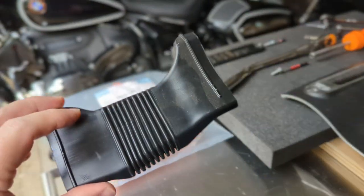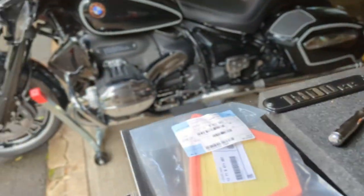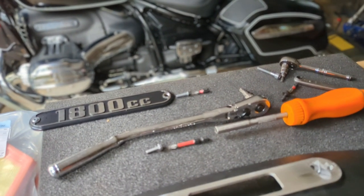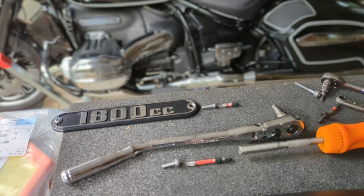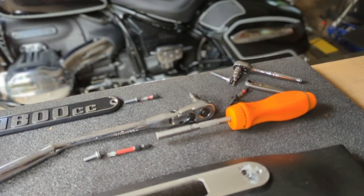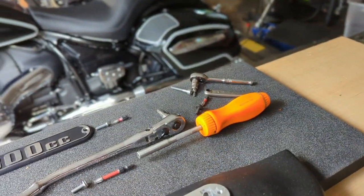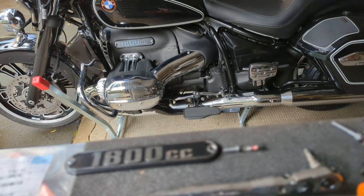In front of me is the airflow piece that attaches to the box on the right-hand side, and I have a new air filter. The tools required: a T20 to remove the engine badge, a T30 for the two bolts on each side holding the upper engine cover — they mount vertically and are hidden behind the engine badge. On top of the engine cover are two T25 bolts that grab onto the left side of the engine cover.